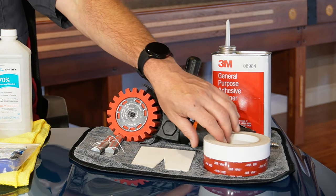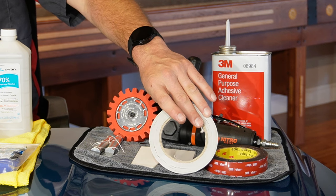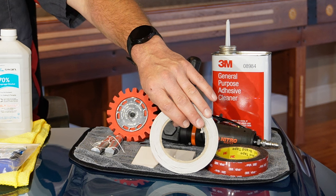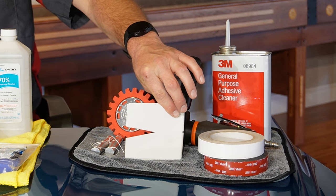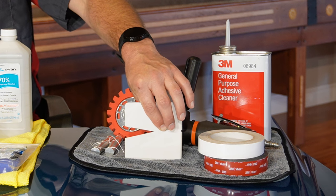As far as reinstalling badging goes, we're going to be using a double-sided 3M tape. If the 3M double-sided tape is too thick, we're going to be using a banner tape and with this one we're going to be using anywhere from one to three layers of it. This here is a tool that we use to reinstall the emblems on Teslas on the hood — it's just a great tool to get them lined up perfectly each time.